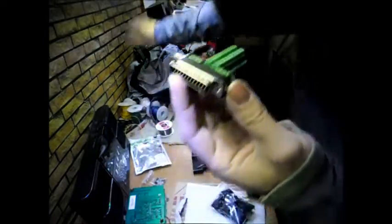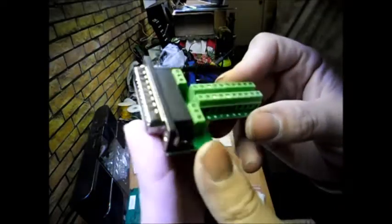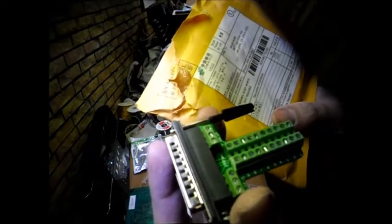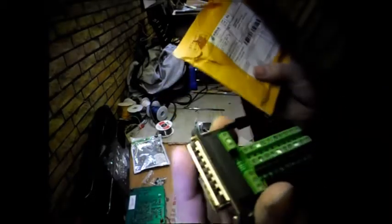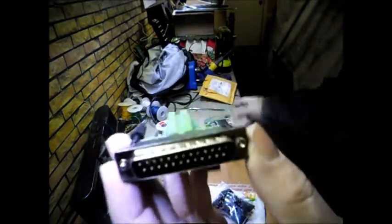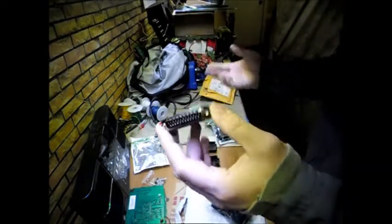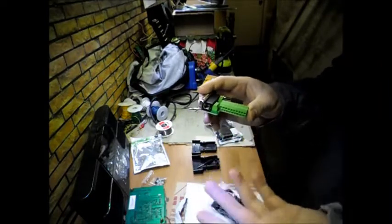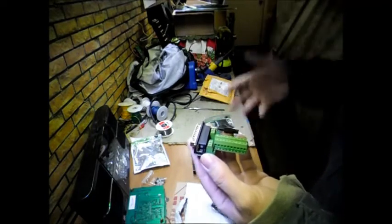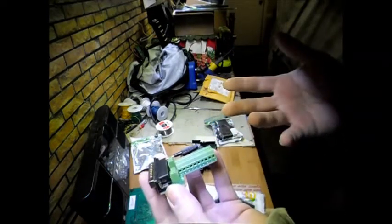I think I paid five or six bucks for this, which is really cheap. It came straight from China. I definitely recommend this - when you hook up your dash electronics from whoever they're from, Jupiter or ZA Electronics or ID Geniali, it's real simple. You're not going to have more than 20 inputs most likely if you're doing a basic hookup: your oil, temp, fuel, RPM - that's only going to take five or six of these connectors.